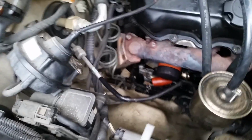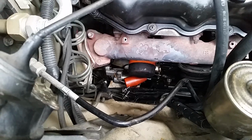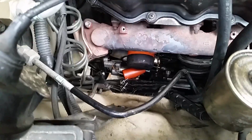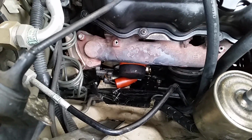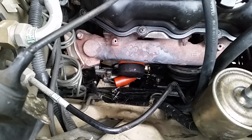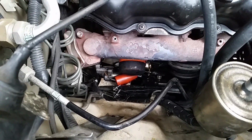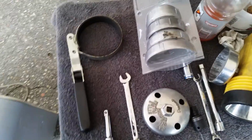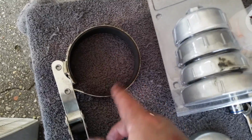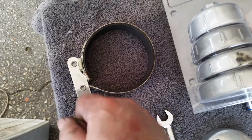Next thing we got to do is get that oil filter out of there. And boy, I'm telling you, those are fun. So the little socket wrenches that go on don't work very well. So what we ended up doing was using one of those expanding oil wrenches that has a 3/8 drive socket inside. So let me go get that, show it to you. All right, I can't find that tool I was talking about, but basically it looks just like this one, and off to the side with no handle on it, it's got a little spot for a 3/8 drive ratchet.